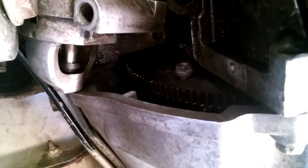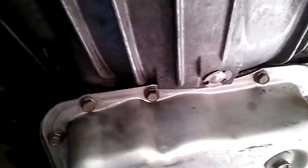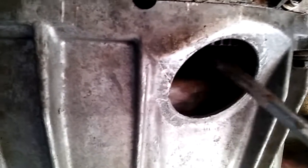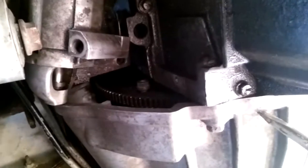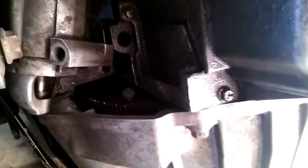We tighten it down a little bit snugger than the others, and all of a sudden the transmission won't move. We tried pushing it with a screwdriver carefully so we don't strip the gears, but it wouldn't move. What was happening is that when you tighten the bolts, the torque converter moves forward and pushes up against the engine block — you can see a bolt right there against the block. That's what was stopping it.